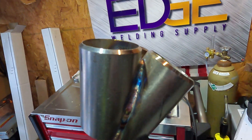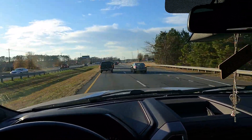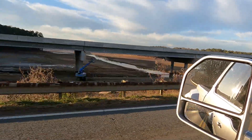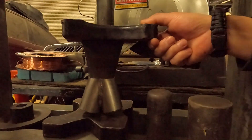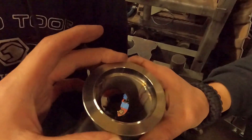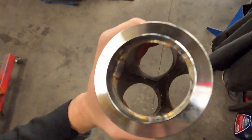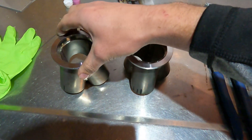We got these collectors all welded up, now we've got to take these things to the exhaust shop and get them expanded out to where we can fit a two and a half inch V-band on them. Now we got these expanded out, the V-band flange sitting on there nice and even — we're ready to rock. Boom — fits like money, look at that!